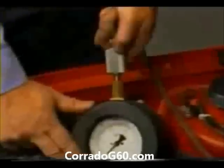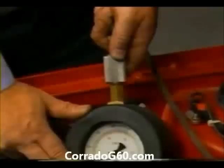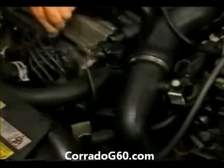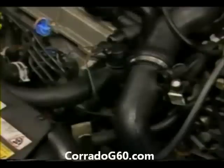The gauge is in the open position when the sliding valve is pushed toward the gauge. Leave the gauge in the open position for the test. With the gauge installed, start the engine and let it run at idle. To keep the engine from surging rapidly when the engine rev limiter kicks in, remove the harness connectors from both the coolant temperature sensor and the CO potentiometer. Removing these connectors will cause the engine to surge at a slower rate. The Digifant ECU should prevent the engine from over-revving.